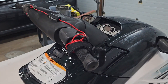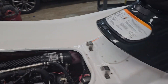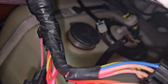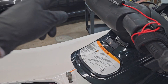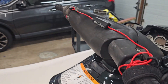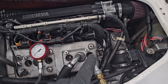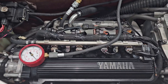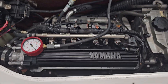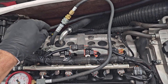The throttle is pinned wide open, which puts the butterfly inside the throttle body completely wide open. I've also disconnected the two electronic plugs on top of the fuel pump so I'm not sending any fuel to the fuel rail. You can also push the stop button at the same time as the start button to override and prevent the fuel pump from kicking. Let's test number one.